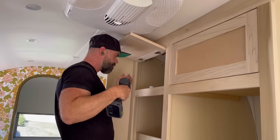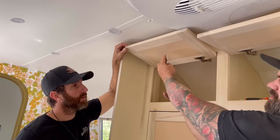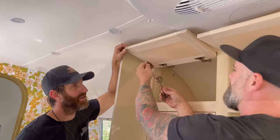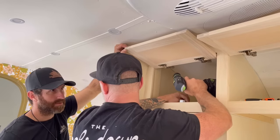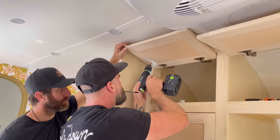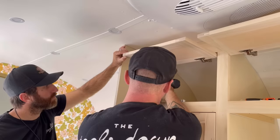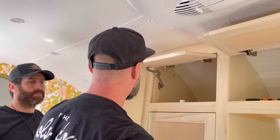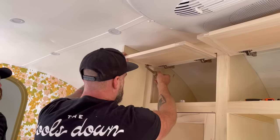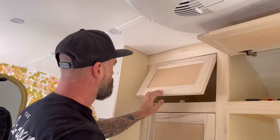Back in the Airstream I installed the corresponding hinge parts inside the cabinet, clipped the doors in place, and they fold down quite nicely. I added magnetic latches to stop the doors from going inside the cabinet box. Then I needed something to keep the cabinet doors open, since they're mounted horizontally — I found these little cabinet-stay locking mechanisms on Amazon and included a link in the description. They're easy to install and you can adjust tension with an Allen wrench depending on how light or heavy your door is.